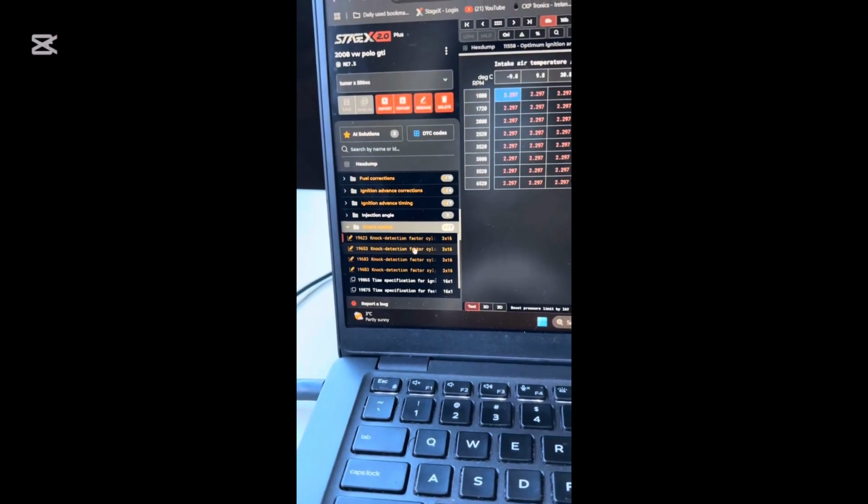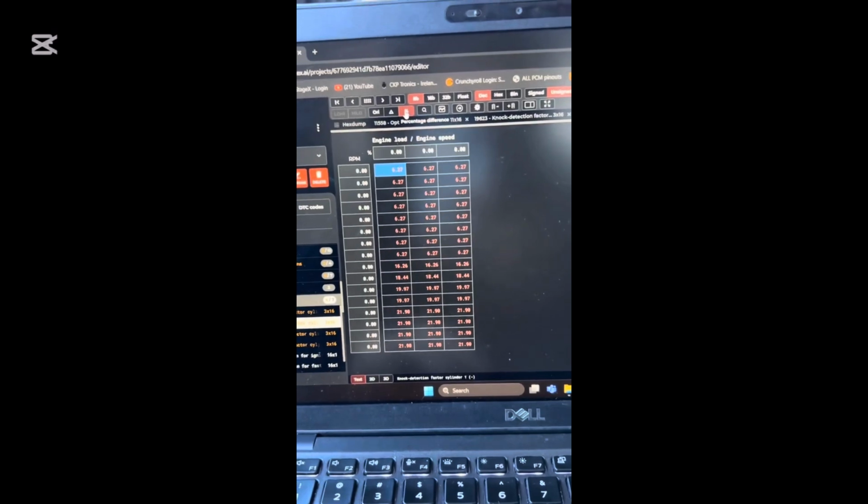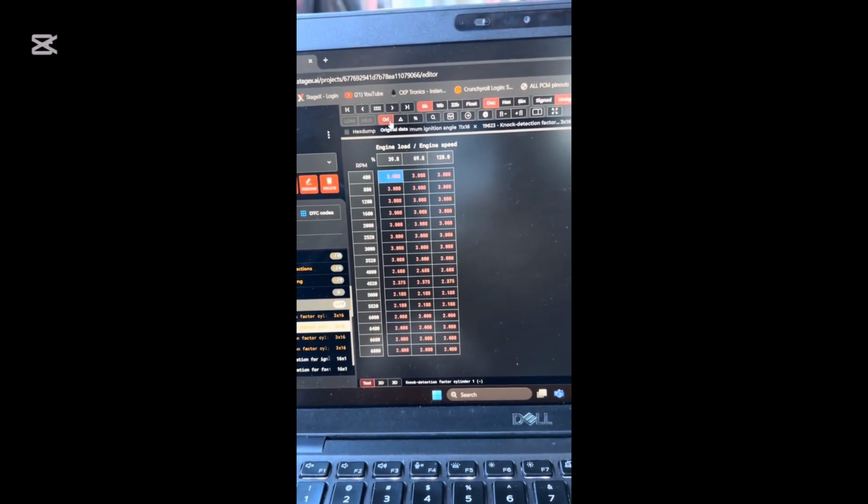And knock detection. Wow. Originally. So actually looking at that, it's not horrendous. They didn't completely turn off knock control, which is nice to see. But there's no reason on earth why knock control should even be touched, because knock control from the standard ECU is dialed in to perfection by the manufacturers, and it keeps the engine safe, and that's why the engines last tens and tens of years on standard file, and that's why they blow up in no time with maps of, well, poor quality maps.